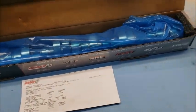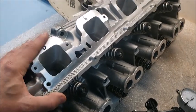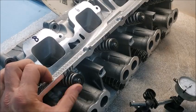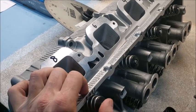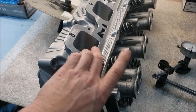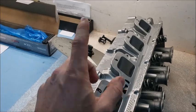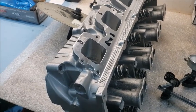We're going to degree the cam. Last week I set up this cylinder head. You'll notice this is the even side — on the odd side I left off a few of these springs. I put in setup springs so I can show you a few different deals: retainer-to-seal clearance, coil bind — I will show you on those too. I've already checked these, but I'll show you how to check spring pressures and installed height.